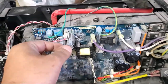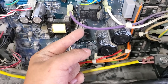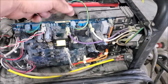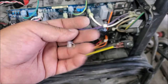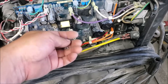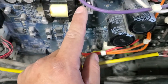Wiggle all these connections off. The way you're going to get to removing this component is through the back — you're going to unsolder it from the back side. Once you have the board in your hand, unsolder it from the back side and push it through. What I ended up doing was cutting all the legs off, then putting my soldering gun at the back, letting the solder melt, pushing it through, and pulling out all the little legs still left in there. Once the holes were clear, I just pushed the new transistor in and soldered it back in.